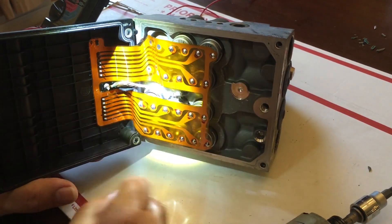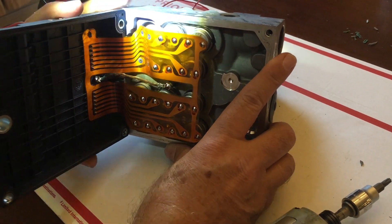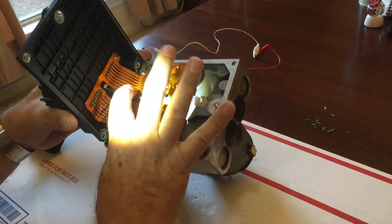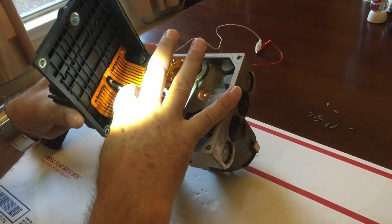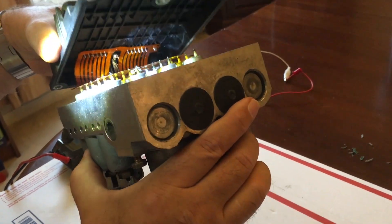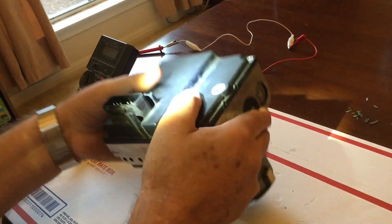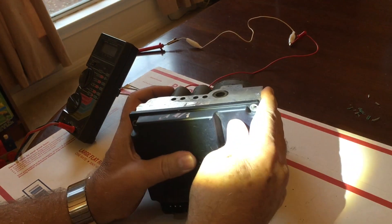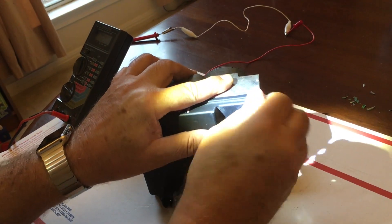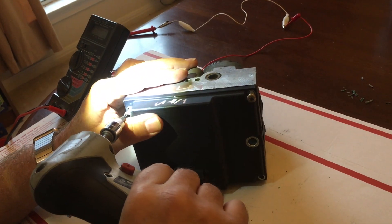Some of it was still left and I peeled off the rest. Now what happens when that insulation is gone — when this thing closes back up, this wire has to bend at about a 180 degree angle and it actually touches the frame when you close it. It's actually touching the aluminum body in here, and I'll show you if I put this cover back on and we measure the resistance.